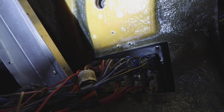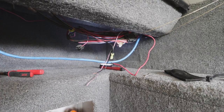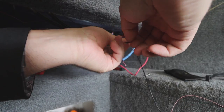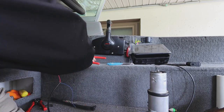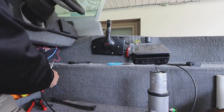I know it looks like a mess up there and it is — it's hard to get to. So if yours looks like this and you really don't know what you're doing, the best thing to do is just come up here and take your panel off and you can easily get to everything behind there. But luckily we got some pigtails down here that are easy to get to. Now before you make any permanent wire connections, like I said, we have the power turned off to the boat. He's got a master switch on here, so there's no power running to this. Do a quick install just to make sure this is going to hold up — I don't want 12 volts running through my fingers.